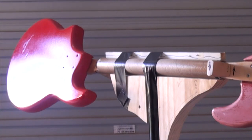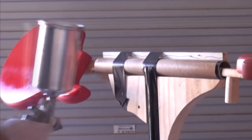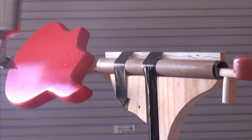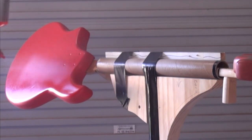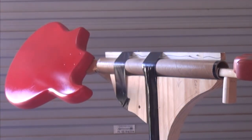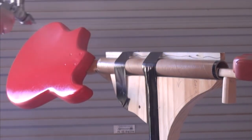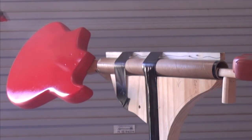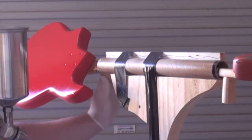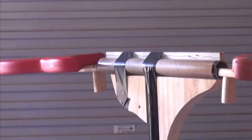I now set the gun to allow a generous amount of paint or clear through in one pass, but only spray two coats and then wait for 15 minutes for it to dry off a bit. This is the best method I have devised to not lay too much too quickly, and patience between the layers pays off rather well. This might be a little too overcautious, but I have avoided runs ever since, except for when the gun is not set up properly, and full flow can cause runs if the pass is not quick enough.